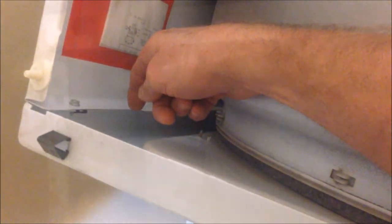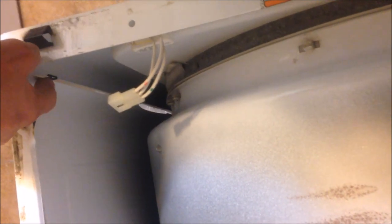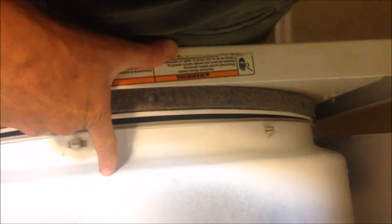With this particular model, I have one solid panel in the front. I'm going to lift the lid up and just lean it out of the way. You need to disconnect this wiring harness right here. And then there's a screw here and there — you're going to take those off. Once you've disconnected your wiring harness and removed the screws on top on each side, this door will actually separate from the drum. You can just lift it right off.